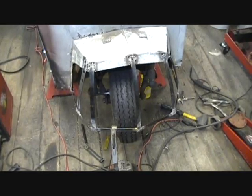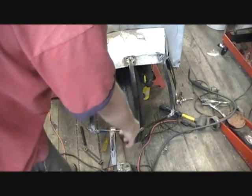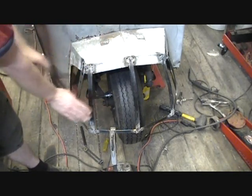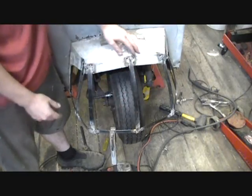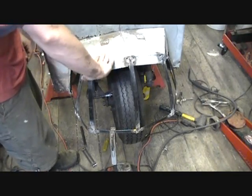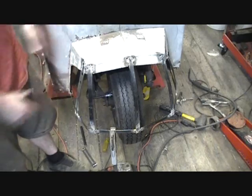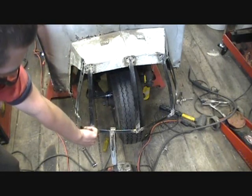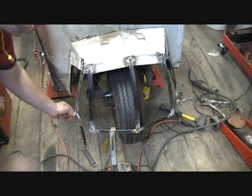Here's where a couple hours of work — or not even that, an hour of work — will get you. Obviously the wheel's not straight. This is the center line, which is pretty good. What I'm going to do is take aluminum and start up here with it. I'm going to put this piece in first, wrap it over like that, then put this piece in second, then this piece — it doesn't matter from that point. It's going to overlap and rivet to this face up here, so you'll see this line. That will help with keeping the seams from wanting to collect junk. And it'll come all the way down, probably hang a little lower than the bottom of this lip. Might even wrap it up under if I can get real crazy with it. And that'll give me a nice look with a nice supporting structure.